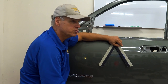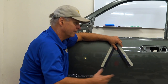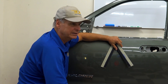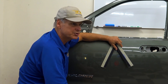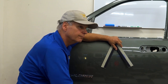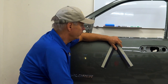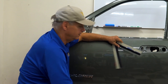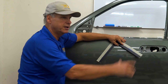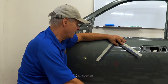Okay? That's where you're going to make the most money, get to a 95 to 98% repair the quickest, and you can easily do 3 or 4 of those a day. So at 90 degrees or less, bread and butter, there is no need to put any tension. Oh boy, you bet there is. Any time I see a dent come in and I know I can put tension on it, ka-ching. I'm going to make my money.